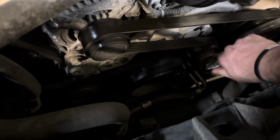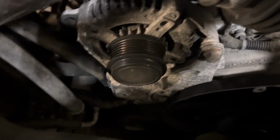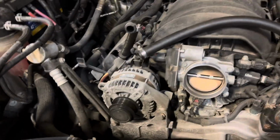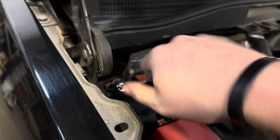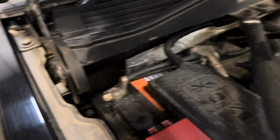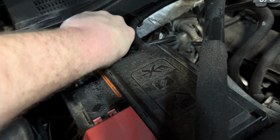The ratchet in there, maybe. Oh, it's under some tension. Let me set you guys down, I'll be right back. All right, cut that off. We'll get this air intake out of the way, where we can see what we're doing. Okay, now you can see what you're doing. Got the intake off. We're gonna disconnect the battery. Should be a 10 millimeter over there. Battery's disconnected.